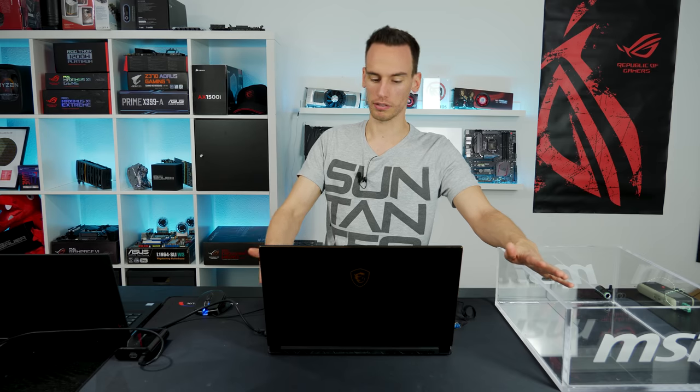There are some parts that can be damaged. For example, a speaker could maybe be damaged, or the fan that's responsible for CPU cooling. And the battery, of course, will also be interesting. I think the battery should not be a problem as long as we just use a normal Novec fluid. We will do something even more special later, and then we will see if we damage something or not. But let's see how high we can push the CPU and the GPU adding some 3M Novec fluid on this laptop.